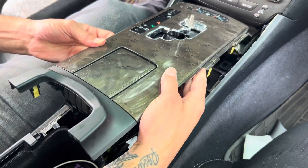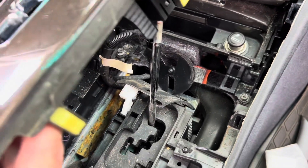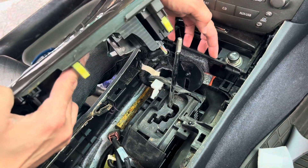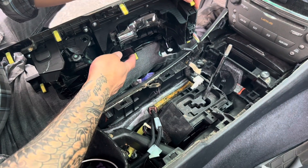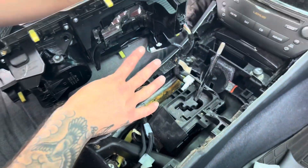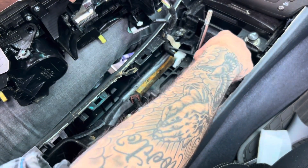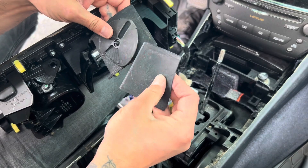All you got to do is pry out from inside the cigarette lighter compartment in the ashtray like this, and you pry carefully undoing the tabs one side at a time. I'm going to keep everything intact — I'm not going to disconnect anything. This is the piece that I'm going to replace. As you can see, it fell apart.